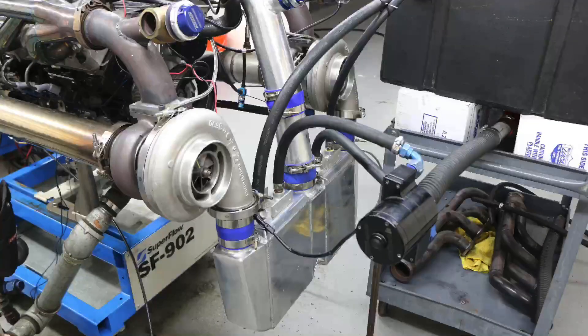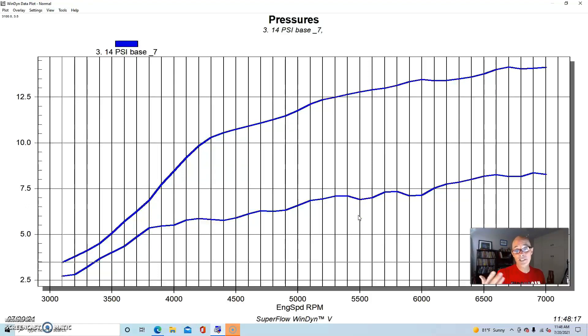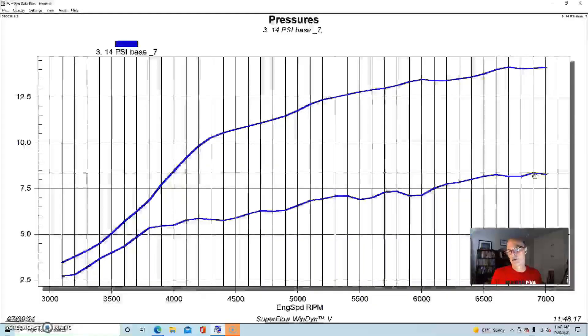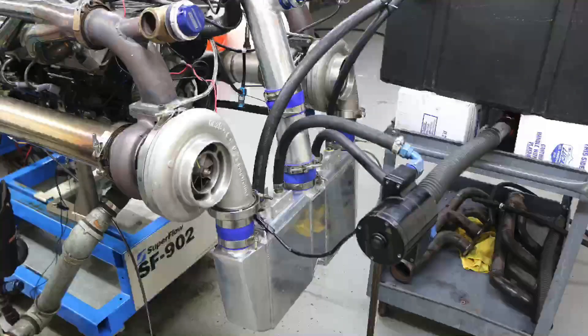It's very important to note that we used a manual wastegate controller on this — basically just a bleed valve, not an electronic controller. One of the primary reasons we saw a jump in power was a jump in boost pressure. With the ambient dyno water, the boost pressure peaked at 14.1 pounds, and the back pressure was only 8.3 pounds — much less back pressure than boost pressure. This is a twin turbo application with fairly large turbos; at this power level we were using about half of what these turbos are capable of.